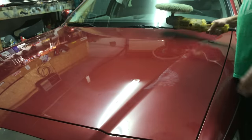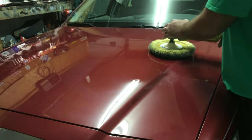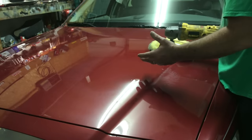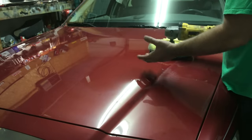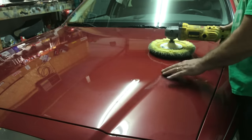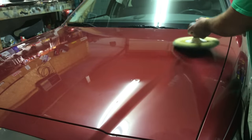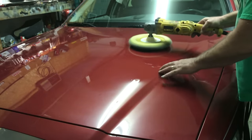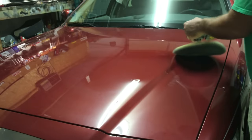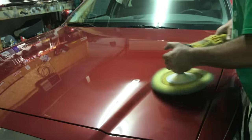Using a single action, I promise you, this is the only way to go. Once you get used to it you'll love it — you'll get the job done fast and get a really nice shine. If you're going over an edge, keep it moving, don't stay in one spot. Hold it on an angle and keep moving.